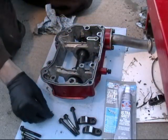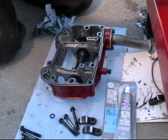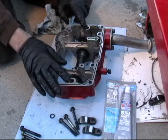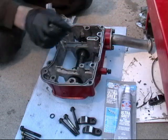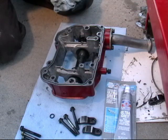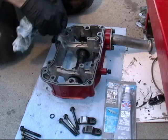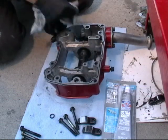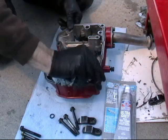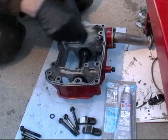Install our O-ring onto our cam tower. I'm going to put that on first, and then move on to putting the lifters in, setting the cam tower on the dowel pins, and threading a couple of bolts to hold it in place so the parts don't fall out. I'm going to clean off any residuals with carb cleaner from the old sealant groove channel on this cam tower. We've already had this at the bench to get all the crud out — this is just one last touch.